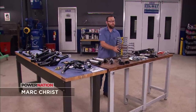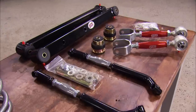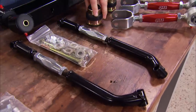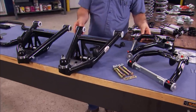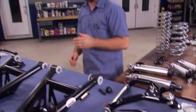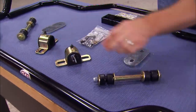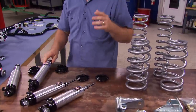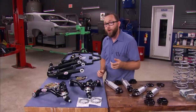To get our Chevelle's chassis where we need it to be, we're going to have to do some serious suspension upgrades. All this stuff on the tables comes as one kit from QA1. All of it bolts in the factory location, starting in the rear with tubular lowers, adjustable uppers, and adjustable trailing arms. It even comes with polyurethane bushings that bolt into the factory housing. For the front, the kit also comes with tubular A-arms, both upper and lower, equipped with QA1's Ultimate Ball Joints — adjustable for both preload and alignment. To keep our Chevelle flat in turns, the kit also comes with heavy-duty sway bars, all the mounting hardware, bushings, and sway bar end links. Of course, the kit wouldn't be complete without QA1's double adjustable coilovers, for 68-72 GM A-bodies — so it fits not just the Chevelle, but also your El Camino, GTO, 442, or even Buick GS.